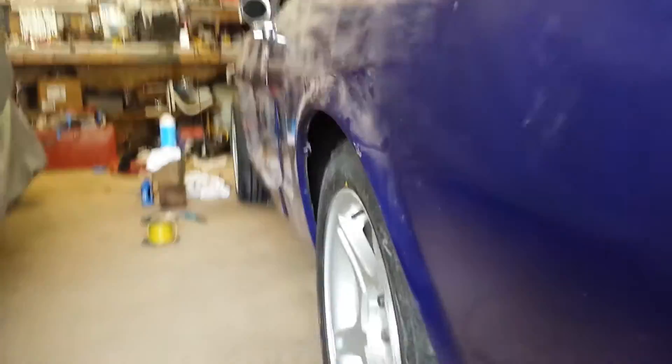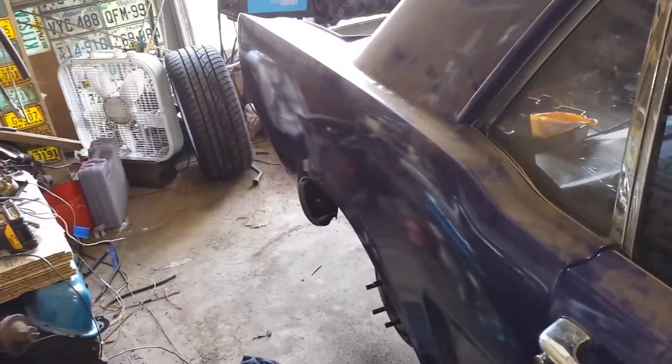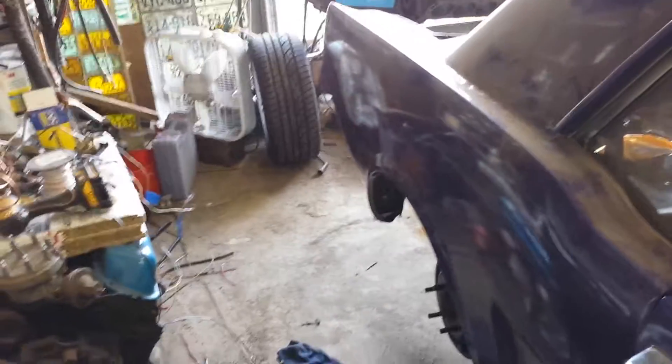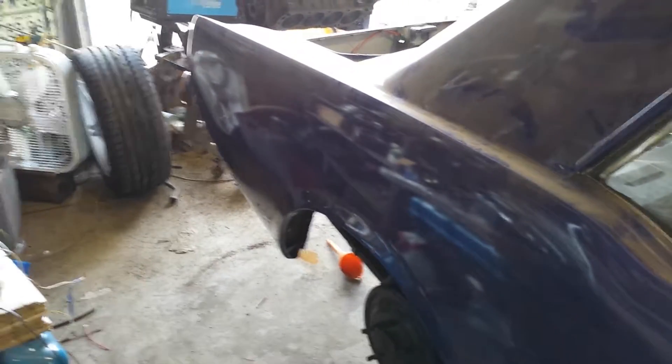You can see the gap here on this fender, and the gap on this other fender. This gap on this side is a little bit bigger. I was thinking that since the leaf spring on that side touched, I needed to move the rear end that way, since it's already further recessed in. But I might just take the adjustment up with some spacers.